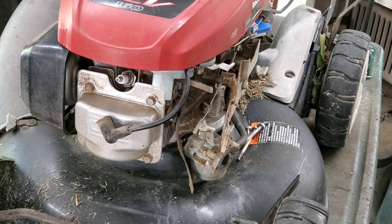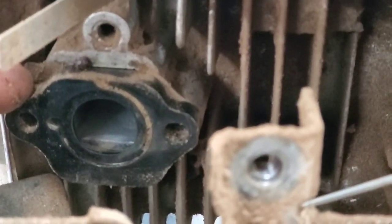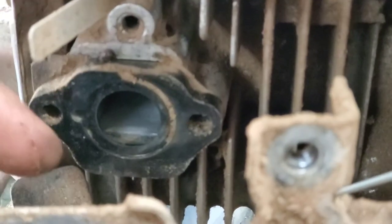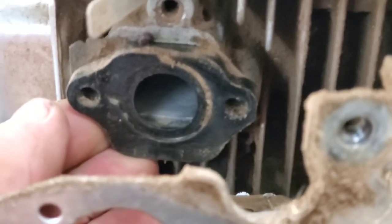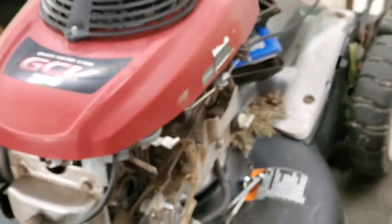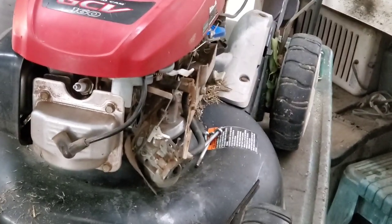I see our problem folks. I'm not going to stop — I want you to take a look with me. I'm going to pull this off, it's going to be a little shaky. I'm looking at this plastic intake. I'm just going to scooch the carburetor back a little bit. This looks to be on upside down. See right there — there's an air leak right there, that crack. This plate should be flipped over. What it's doing is sucking air — that is why.